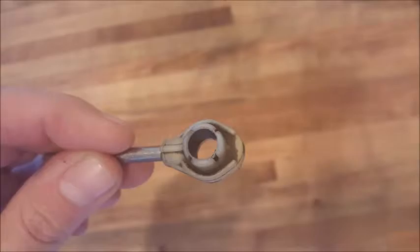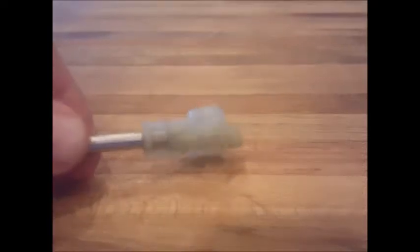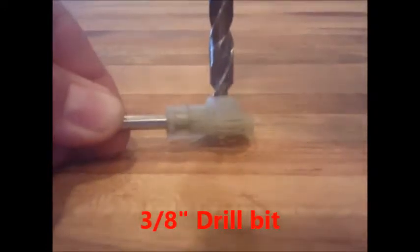If when you're drilling out with the 11/32nds drill bit it begins to chunk, comes out in several pieces, falls apart, or comes out entirely, rather than using the black bushing, you will use the green bushing.